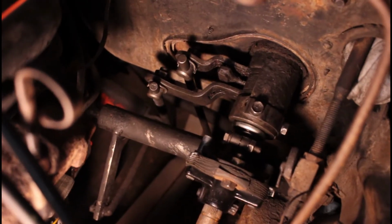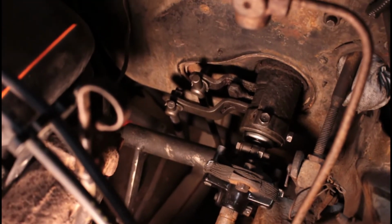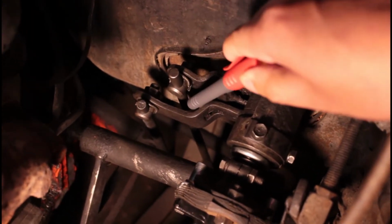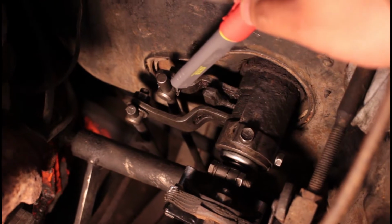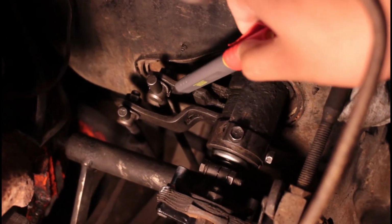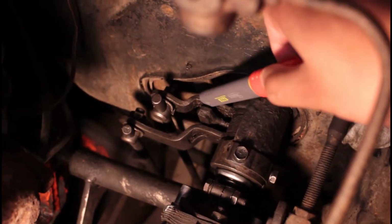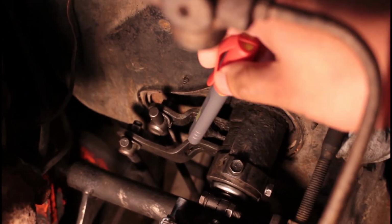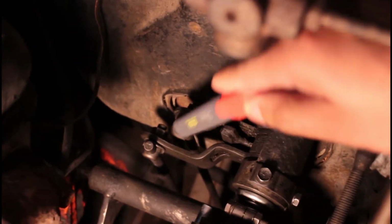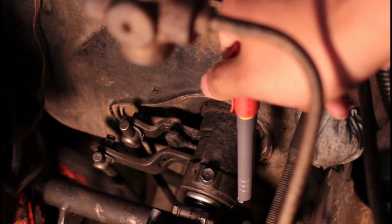I also want to say there's a serious lack of respect here for me. This car has a serious lack of respect. I had to make some more adjustments. It wasn't going down to third. It would kind of stop. So I thought about it intuitively and the angle it was going down, and realized I had to move it up. And sure enough, moving it further up, the arm here ended up working to get down to third. But when I moved this up, I had to move this up as well. So you're gonna bounce around between these and fine tune it to get it to line up.